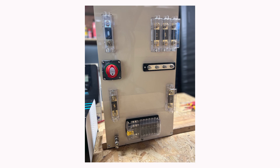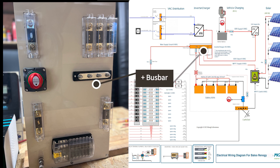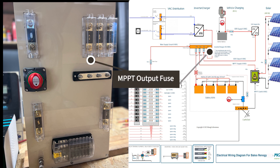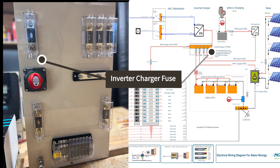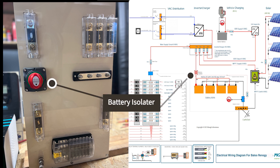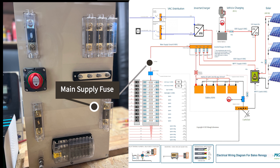I've used the design tool to help me work out where things should go. Our first fuse is the B2B inlet fuse coming from the engine battery to our battery via the B2B charger. That is the outlet fuse which leads to the busbar sitting here. Also fitted to that busbar is the MPPT fuse. Now because my busbar is only 150 amps and my inverter charger is 200 amps, I'm connecting that directly to the battery isolator switch, and off the battery isolator switch is the main battery fuse.